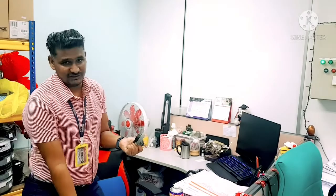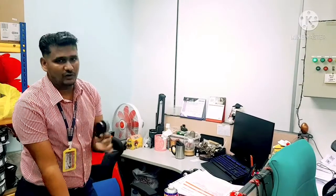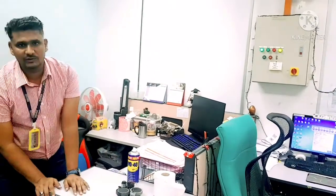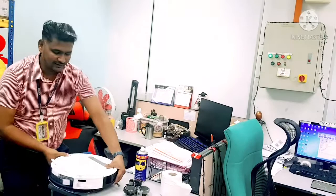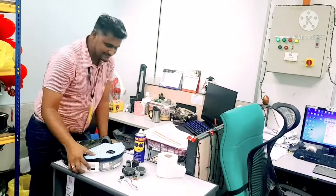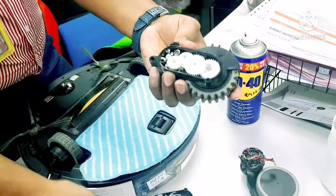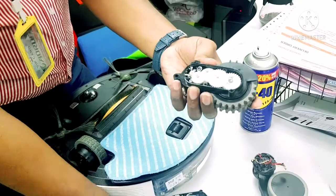So what we do — once we open it — but sometimes before we open, you can try something at home first. Any model you are using, any Deebot or vacuuming robot, what can happen is: if the machine is turning to one side, put it upside down. Inside all the wheels, any model you are using, there are gears. Sometimes those gears jam or get stuck because of lack of lubricant or something similar.